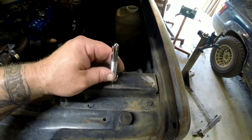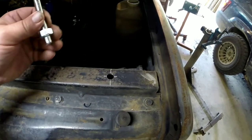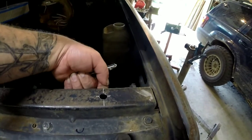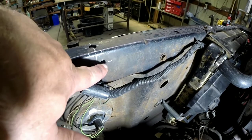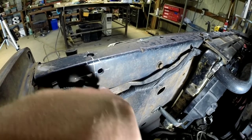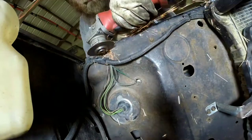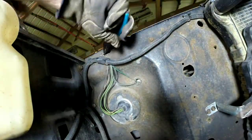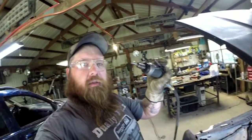These pins are 7/16ths, so with a half-inch hole I've got a little bit of movement — enough for some adjustability. Now I need to make some sort of an access hole on one side so I can get a wrench in there to be able to get the nut on the bottom side. For my access hole, I've drilled a couple of holes and I'll take a die grinder and cut across there just to make a slot big enough to get a wrench in. Now I'll clean it up a little bit with the carbide bit on my die grinder.